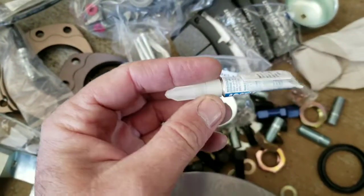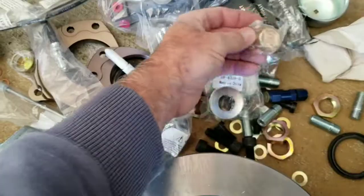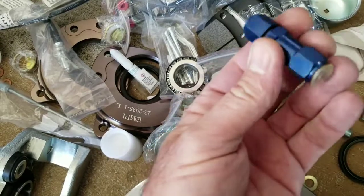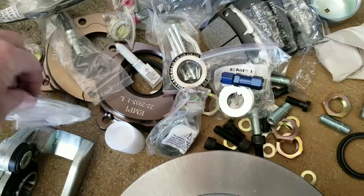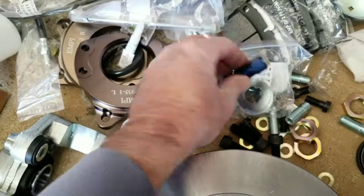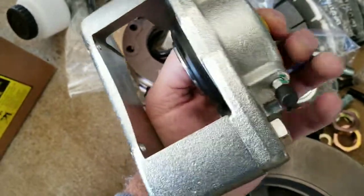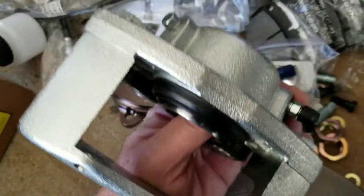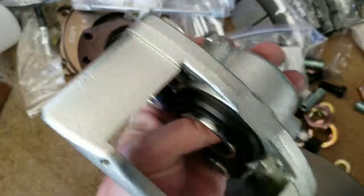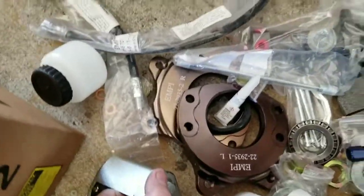Some sort of Loctite comes in here — I'll find out what that's for, maybe I'll look at the instructions. There's also a lightweight aluminum piece that might have something to do with the single brake line. I think they use two rights or something like that and you have to move the bleeder. The calipers are universal — so you have a bleeder here, and for the other side you flip it so that it's facing the right direction, otherwise you won't be able to bleed your brakes.